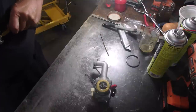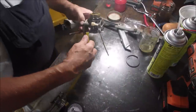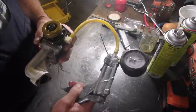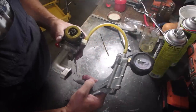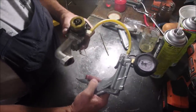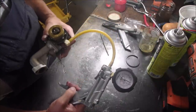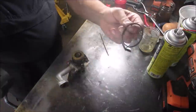This was given to me by Ken from Ken Small Engines — I can't believe he sent this to me. This is a Mighty Vac pressure tester. Now, this has to be vertical. Okay, we're at eight pounds. I'm going to flip this. If it holds more than even six, we're good. Yeah, it's holding six... seven. I'm happy with seven all day long. I'll even go down to five if I'm desperate on an old one. Look at that — see? That cracked.